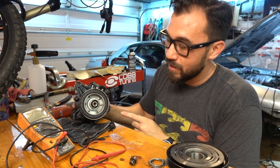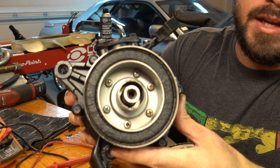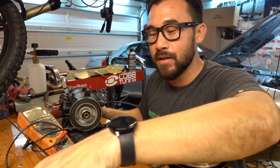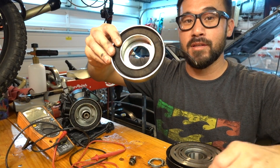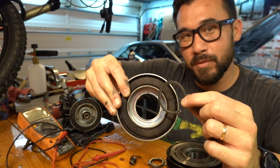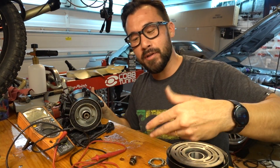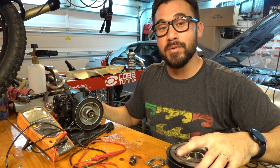There's the coil here. This coil, if you look inside of it, is held on with Phillips screws. All you've got to do is take these Phillips screws out and replace the coil - it's that simple. Just put it back in the same orientation you took it out, where this wire sticks right out. If you look at my Skyline one, there's no Phillips screws - it uses a snap ring, and that can be a little challenging to do on the car depending on how much room you have. I had to take the radiator out to be able to use the pliers in there. But pretty much you just replace it with the new one, slap it all back together, and make sure you don't forget the washer. That's pretty much it - it's pretty simple how to replace it.